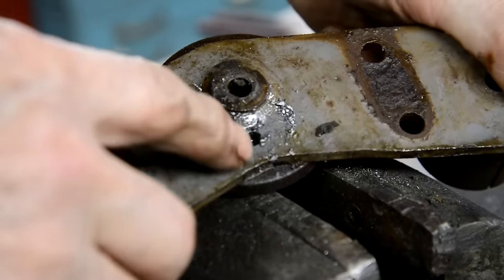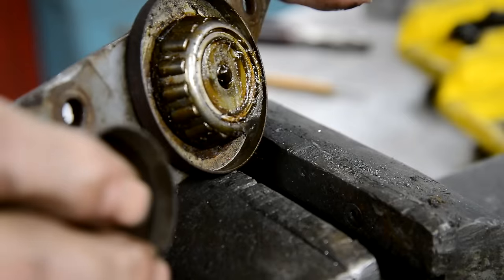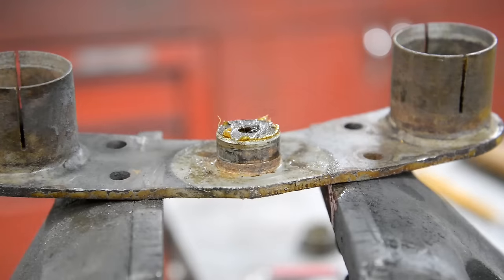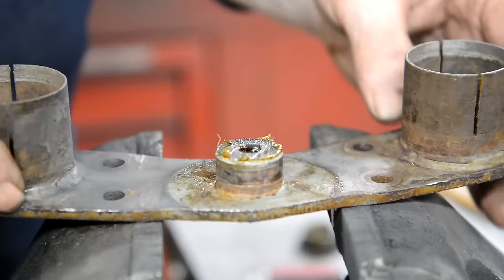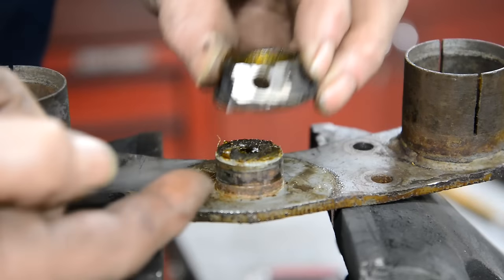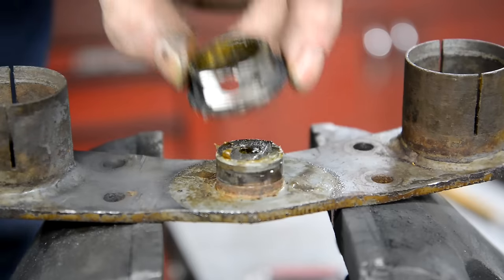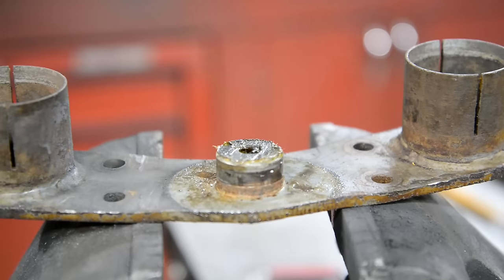I've drilled my hole and I very carefully measured to make sure I am on the bearing. These are unbelievable. All right, let's press on. Well, you learn as you go along, don't you? So this one, I'd drilled a hole through, and because I couldn't cut at an angle, I just went up and down with the disc and ground it away. And then actually it just popped off. That sort of broke it off. You can see it's not rusted. There's just an incredibly tight fit on there. All right, so I'll clean this up, bead blast it, and that's all ready to go for paint.